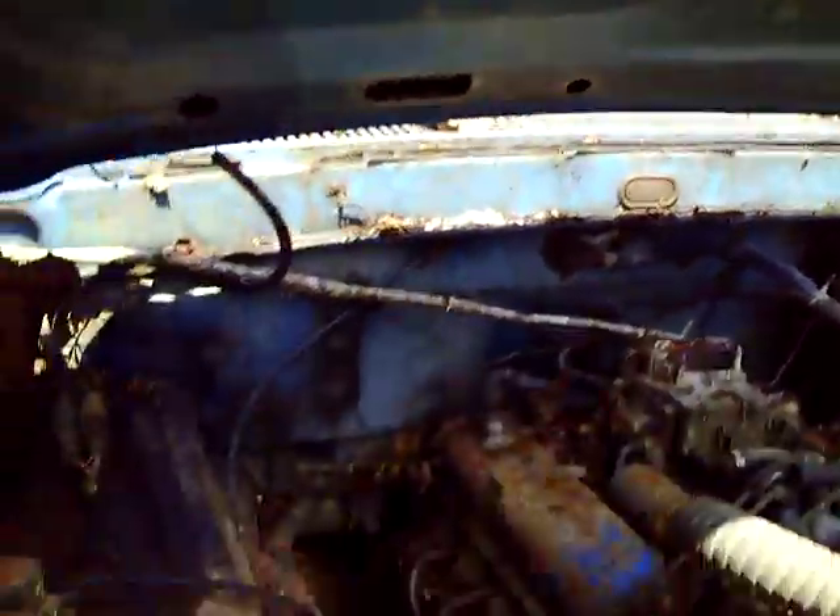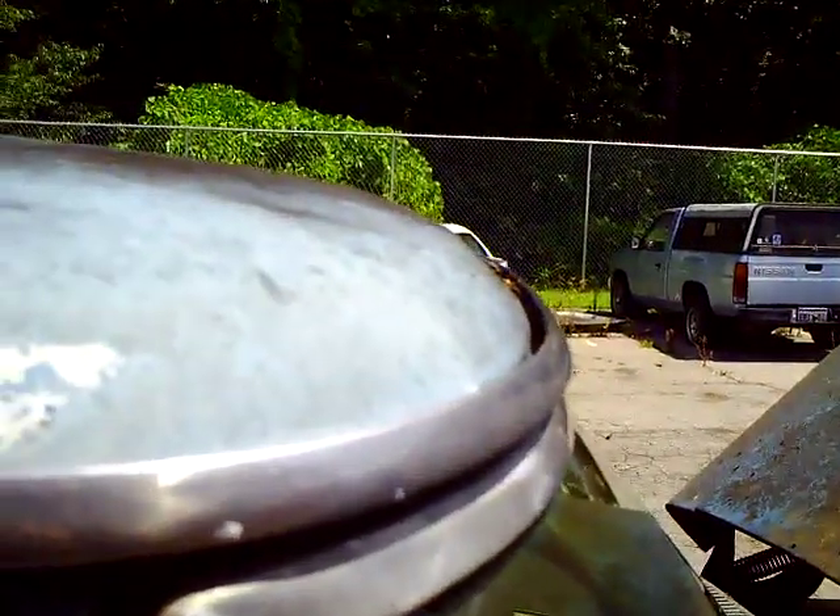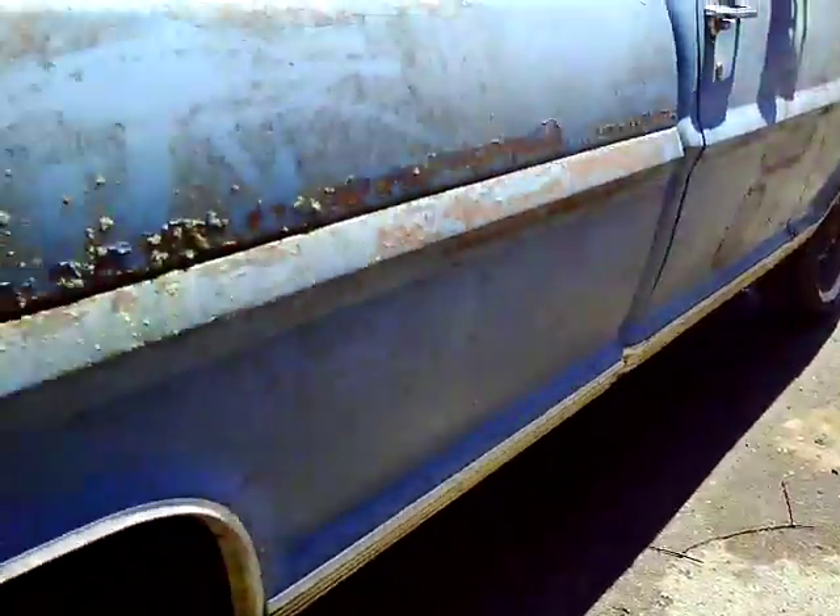There are only a few areas I think can be fixed fairly easily. The hood is in a lot better shape than mine. There's a spot right here behind the fender that could be fixed fairly easy, and a spot right here on the top — we can take the headliner out, sandblast that out, weld a piece of metal in, and have the body shop fix that. I'm hoping I can scrape up enough money for the paint, because even though it's a very straight body with very little rust, the most rusty part is the tailgate.